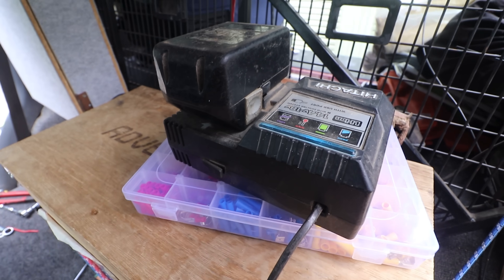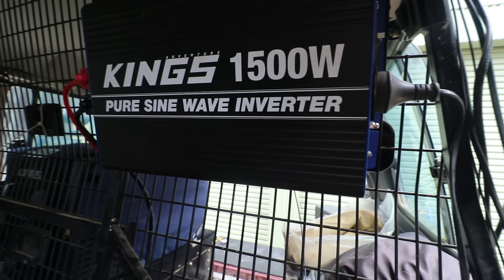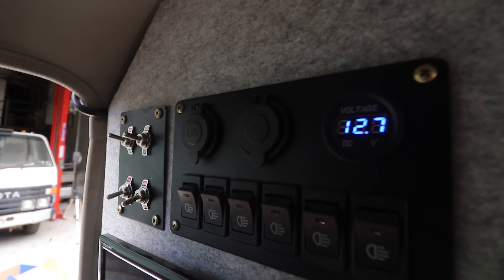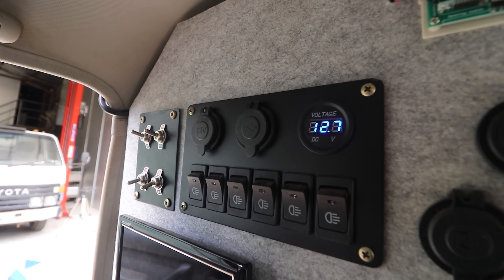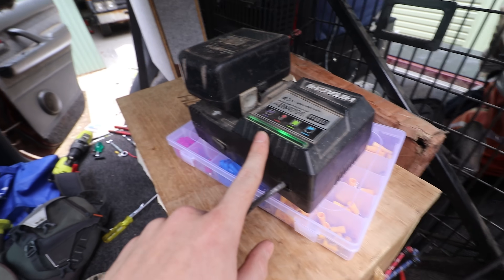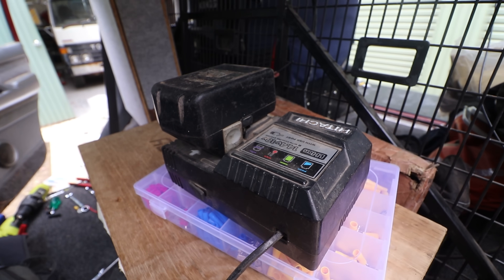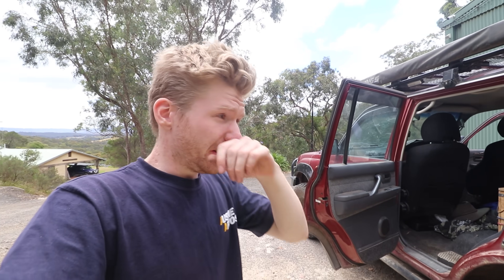It's charging! 240 volts — that's going. Voltage has dropped down to 12.7 and that's the battery already finished charging because it's basically already full. 240 in the car — that was so easy. Literally two cables to your battery and you've got 240 volts. Yeah, interesting to see how the inverter goes on the trip.